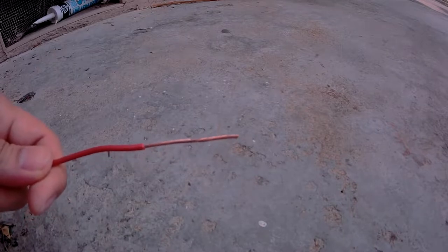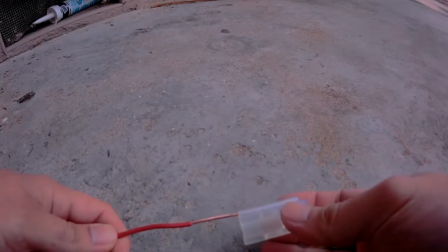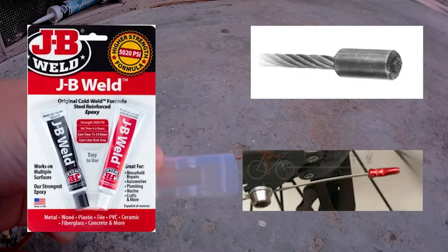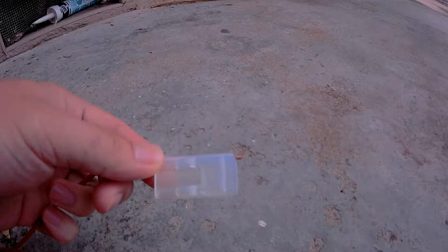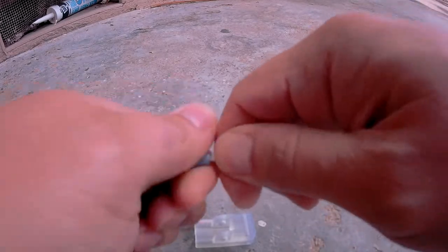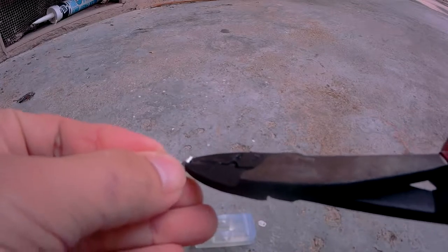Here's a quick recommendation. Since it's a tight squeeze down this hole, you can barely get any glue in it. But the wire is sticking out just a little bit on the back side — to take advantage of that, you can apply more glue on the back side. Or you can use a ferrule, or even use the end caps for the brake lines of a bike. If you're using a ferrule or an end cap, you want to make sure the outer diameter is less than 5 millimeters — if it's not, you can always grind it down. Or if you have a bunch of these laying around, all you have to do is remove the insulation, grip both ends, wiggle it back and forth, and it should just pop right out. There should be a line right down the middle enabling us to open this wider so it could fit on a bigger cable.